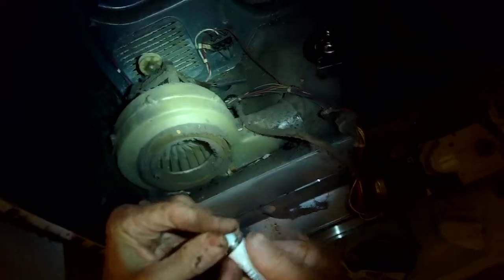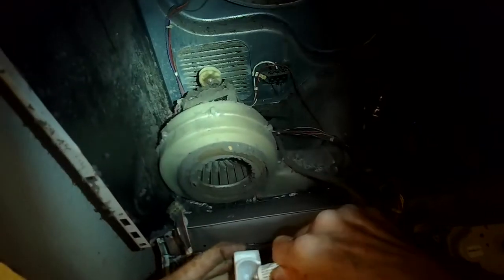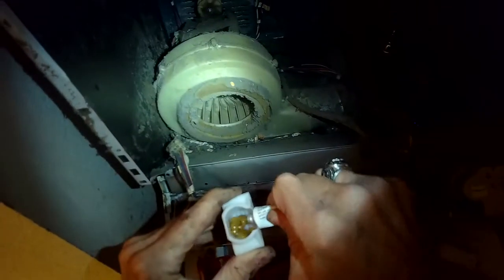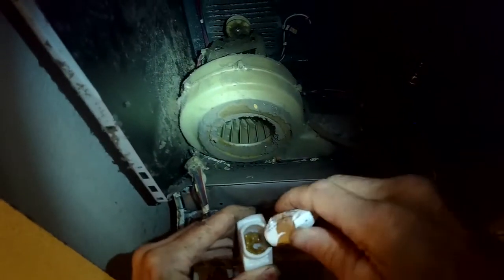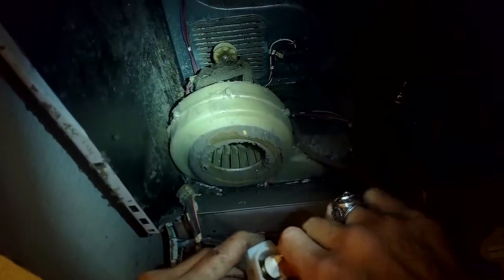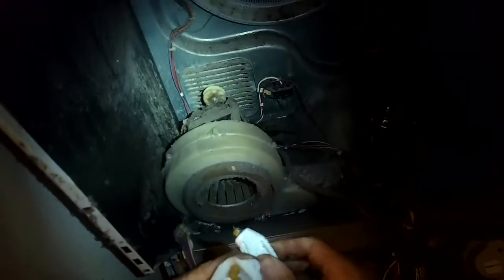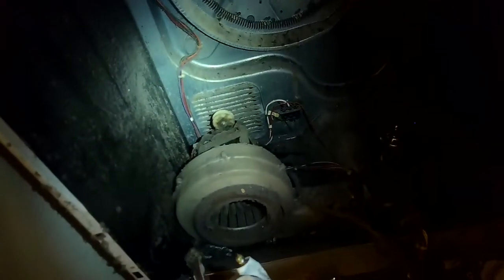328-1153. And it's a really nice kit. It comes with this high temperature grease. We're going to squeeze a bunch of it like toothpaste into this plastic cup, and that metal ball behind the tumbler rests into this cup. So that lubrication, that grease, really helps to make it spin smoothly, and it lasts a long time.